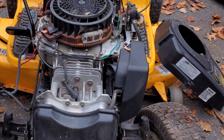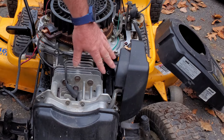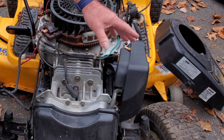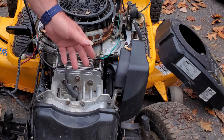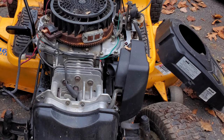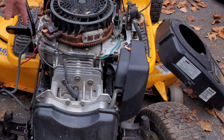Everybody does videos on these Kohler Courage, and I'm going to get to the point fairly quick. I've seen videos where they talk about the problems with the carburetor — those can be fixed. They talk about this cork valve cover gasket leaking — that can be fixed. They talk about this gasket here, how the bolts come loose a little bit and it starts to leak — that can be fixed. The crank seal starts leaking on the bottom, and as long as the block isn't damaged to the point where they ran out of oil, you can put a new seal in. Those things can all be fixed.